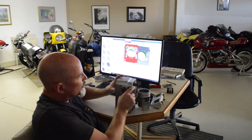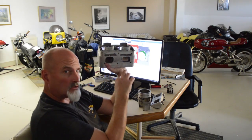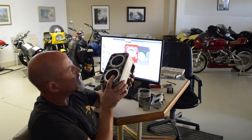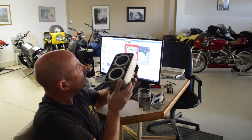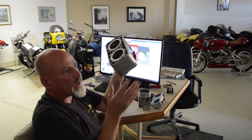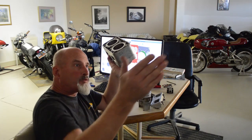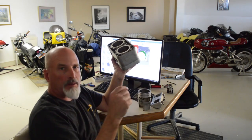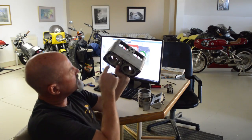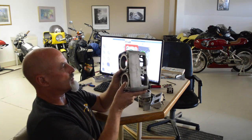The last engine was a complete one-piece cylinder; this one I went with a two-piece because it was the only way I could get in and machine the auxiliary exhaust ports. The previous cylinder was a single exhaust port — this one is a triple. It wasn't done very well because I had limited knowledge, but as you can see, the auxiliary ports are big square shapes, which is not the right way to do it. Auxiliary ports need to be nice tapered triangle shapes so the gases have velocity and somewhere to go.